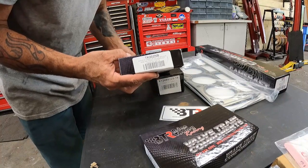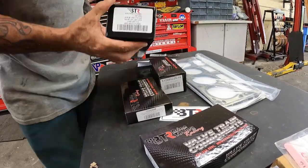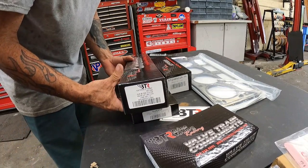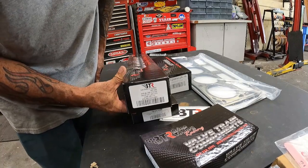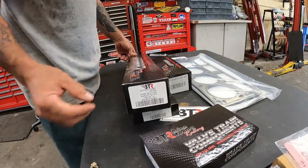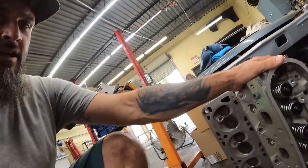So, you know, in conjunction with this cam, which is a bit rowdier than I would want, really. Guy Jacob there recommended it. Or Jacob? Anyway, it's the Stage 2 4.8 turbo cam. We'll see. It requires a dual spring, which I do have a set of heads that have those dual springs on it already. I've got a set of 799 heads.